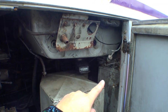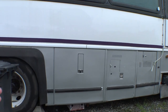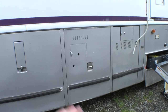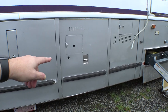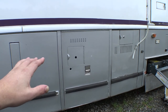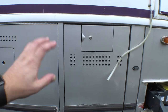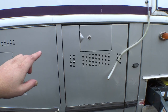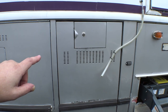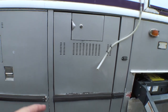We also have access to the air valves to dump off the airbags in the back — those are suspension airbags — and pass through on the other side of the plumbing bay. In this compartment here we have the chassis power distribution. There are two 8D-sized batteries in series to run mostly electrical, and also a 24-to-12-volt converter because some of the lighting and accessories run on 12 volts while the main chassis runs on 24. And in this little part right here we have a fuel tank. The sticker says anywhere between 246 and 289 gallons — we've put more than 280 gallons in at one point, so I'm just going to say it's a 300-gallon tank.